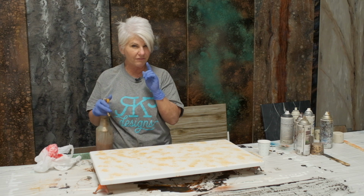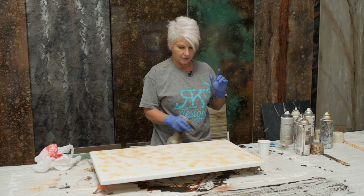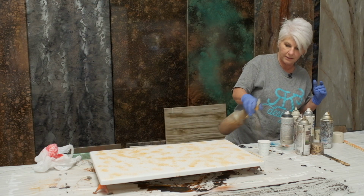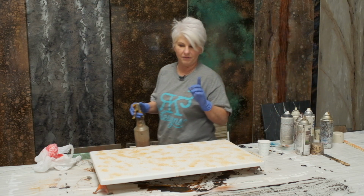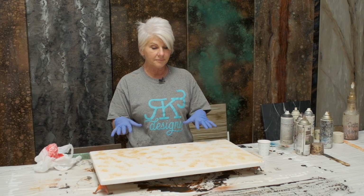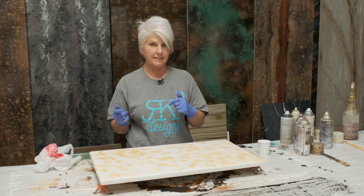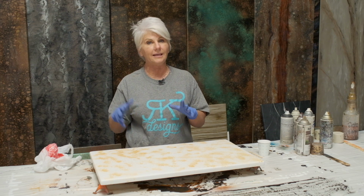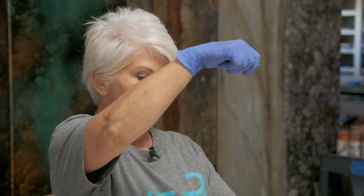Now I'm gonna go a little bit finer mist, and I'm gonna hit my edges, knowing that my edges are going to run just a little bit. So I'm really not too worried about that. I'm gonna come around the front and do the front. Okay, so what I'm gonna do is let this dry, and then we'll come back and do the next step. You can force dry this, meaning you can get a heat gun, come up nice and high, and force dry this, but be really careful that you don't cause it to run and make a really melded finish. I like to basically let it air dry.